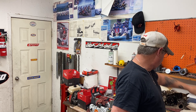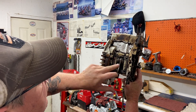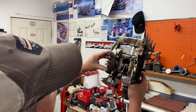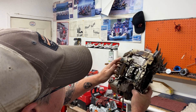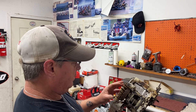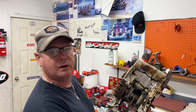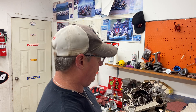This is an 066 old bottom end. The crankshaft is in perfect good shape, but there's a chunk out of the crankcase. It looks like someone took it apart trying to remove the clutch without the cylinder and piston on it, and the rod smacked here and broke — just wrecked that case. Clutch side is still good, crank's good. These old 066 cranks lasted 20 years — just amazing.